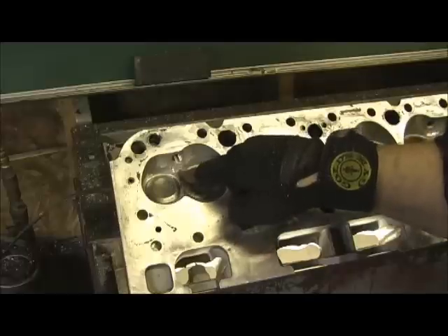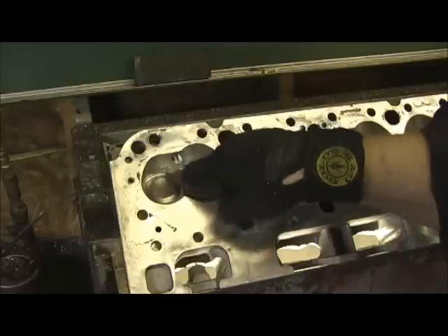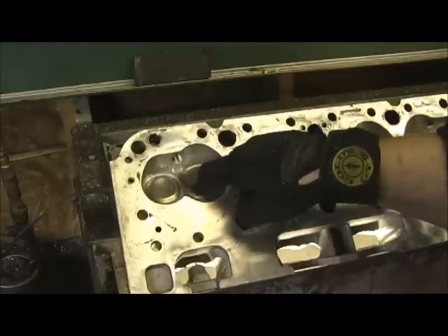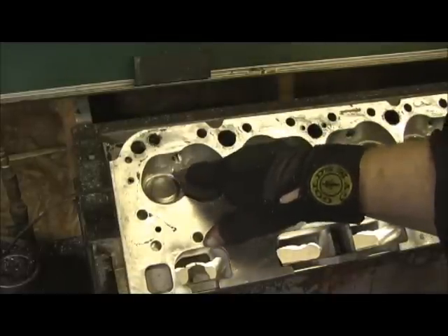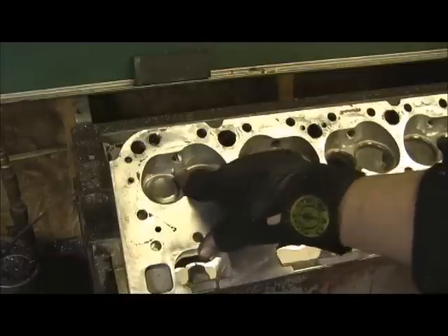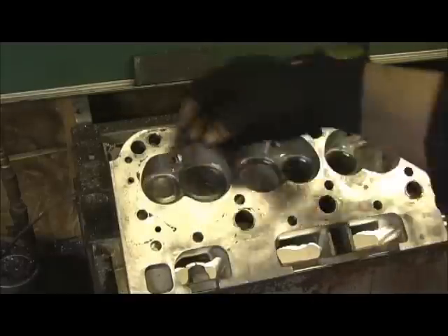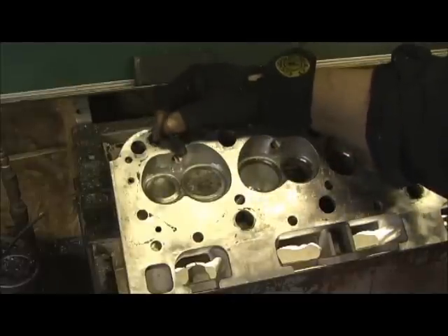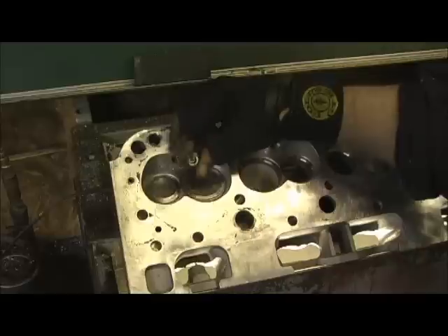327 inches — the compression is going to kill me. So normally I take out this hump, pull that in and come up to unshroud the valves, but I can't do it this time. So it was just a careful measure of being able to go in there and just grind from here to here, here and here, to level the combustion chamber side to where it barely kisses off.